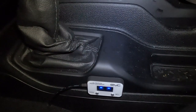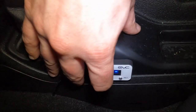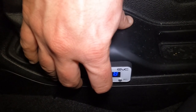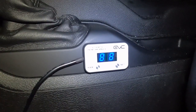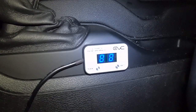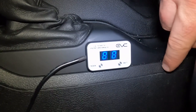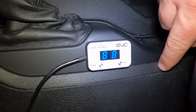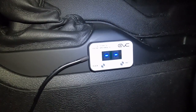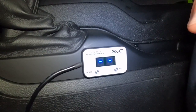So if we go down here, this is the B button. Hold this for three seconds — one Mississippi, two Mississippi, three Mississippi. It says for automatic transmissions, the display must be set to eight, eight. Once the desired setting is chosen, exit the transmission setup mode by pressing the B button once. All right, now we have the mode — we've got ultimate, economy, and automatic.